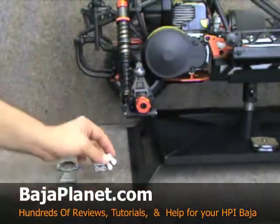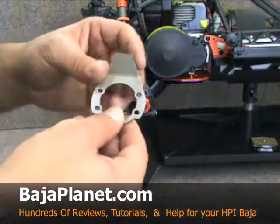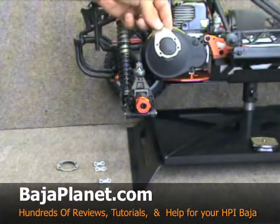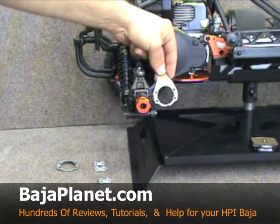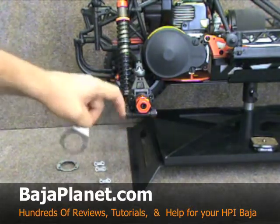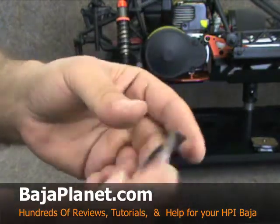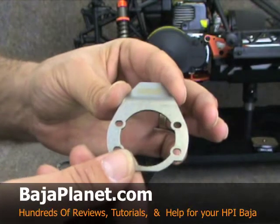The second product we're going to be installing at the same time is a rear carrier stiffener. These are made out of stainless steel, and basically they're going to slide in behind your toe shims just like so, adding stiffness to the entire rear portion of the carrier. They are put out by GBE, and they are both very well-made products. Let's go ahead and install these.